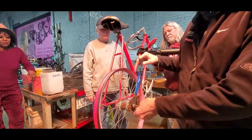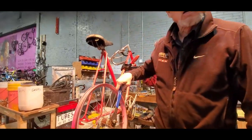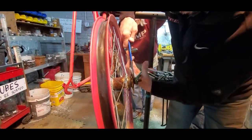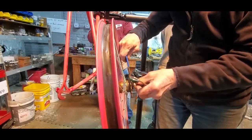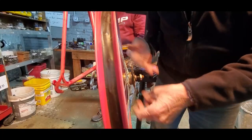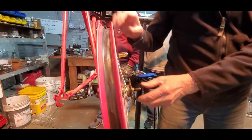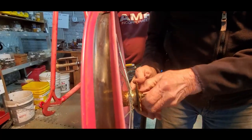I'm going to unlock it, so we're going to have the young lady step around this side so you can see. All the action's happening over here. The cone wrench is up against the 15; the lock nut is a 17. I unlock the 17 and spin it off. Again, some of these only go on one way, but mostly they go on either way. Follow the dotted line — it goes out and it's next in place. Then off comes the cone. There's a set of bearings behind it, and it comes out.